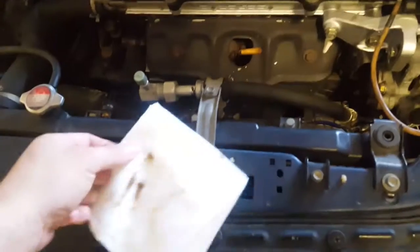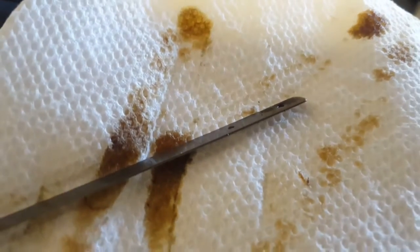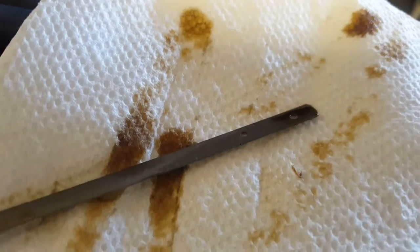which we're going to do by pulling out our dipstick, wiping it clean, reinserting, and then checking it. Now that it's been wiped, we're going to check again. Let's see if we can tell. Okay, I'm not sure if the camera's really picking it up, but we're right in between the two dots, which indicates we're about half a quart low of the maximum available space in the engine.